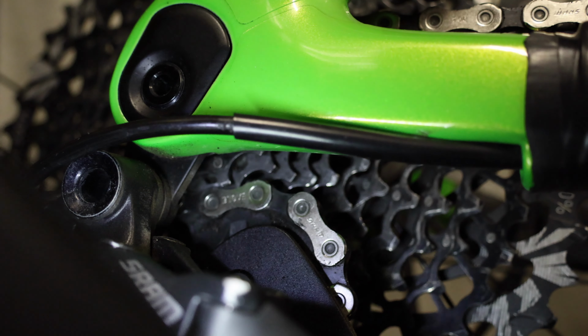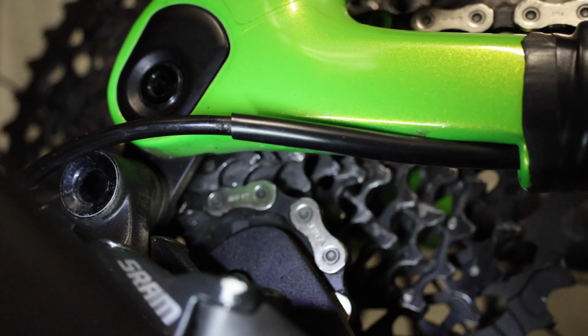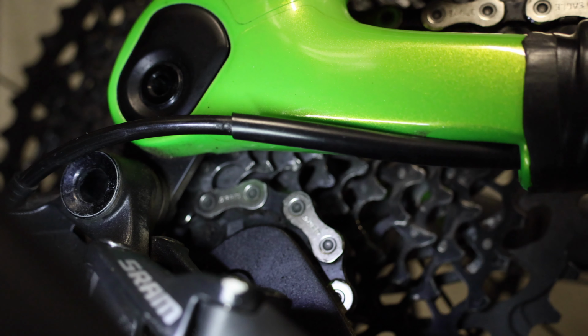Okay, so in the higher gears, same thing. You can see the cassette, the sprockets, and the jockey wheel, and that's with no person on the bike. There's still no clashing of teeth, but just off. So we've got clearance. Now that keeps the jockey wheel so close to the cassette that it stops the skip.